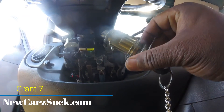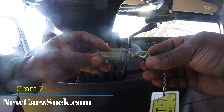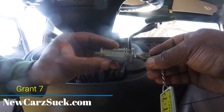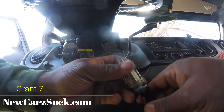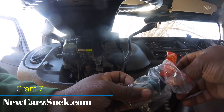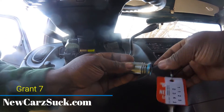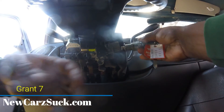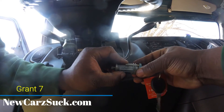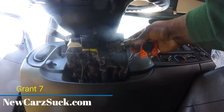There's the lock cylinder. What you're looking for is this tab right here — see that tab I'm pushing? You can only get to that when the key is in the accessory position; other than that it will not work. I'm not changing the tumbler so for me it's only going to take a minute. Put it back to accessory position — now you know you're in the right place because you can push the tab — and push this in.